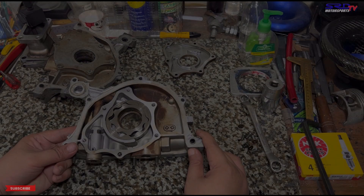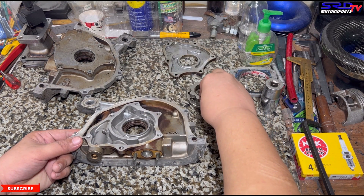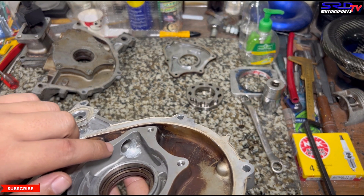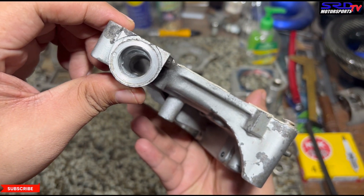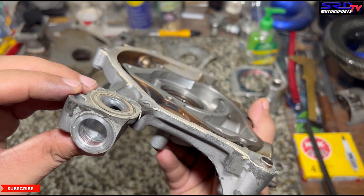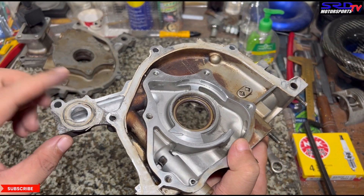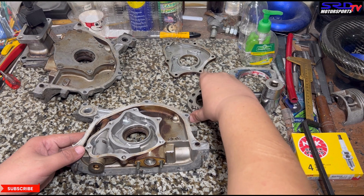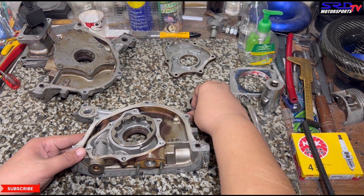Now let's remove the gears — we actually ported this one, cleaned it up, and assembled it, so let's remove this to show you. As we showed earlier, look at this — now it's flared, like a velocity stack, which lets flow enter better. The corner here we removed and blended — you can see it's through and through. This is much the same as a cylinder head: go too much and you kill oil speed. Like I said earlier, we actually just blueprint the cover and get all the clearances good — we rarely port the oil pump, but it's worth showing you.